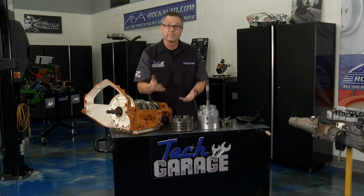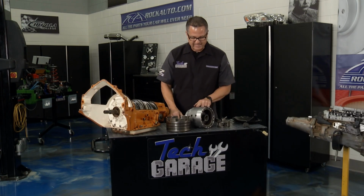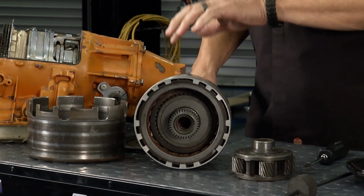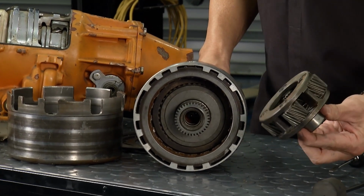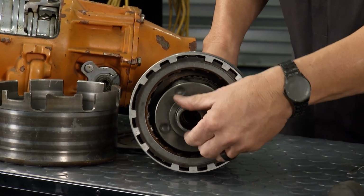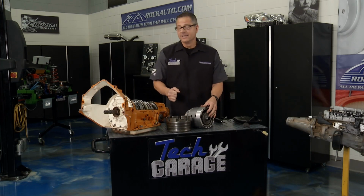Well, what's a driving member of the transmission? Well, I got one right here. You can actually see the clutch packs inside, the clutch packs are free. Bam, I shifted into gear, fluid behind here, piston engages, and I'm locking either a sun gear or planetary gear set, spline right there, spinning around, driving the gears. First, second, third gear, whatever it takes. Speaking of shifting gears, let's check in with Brian.